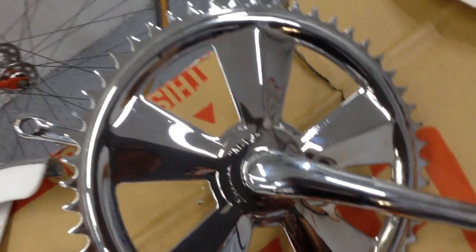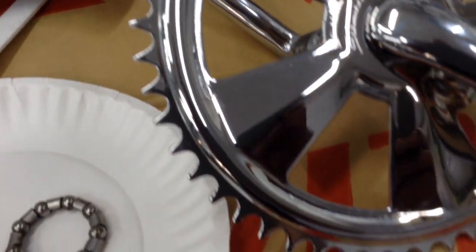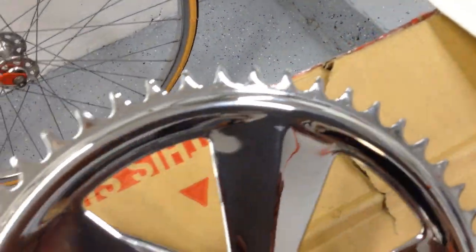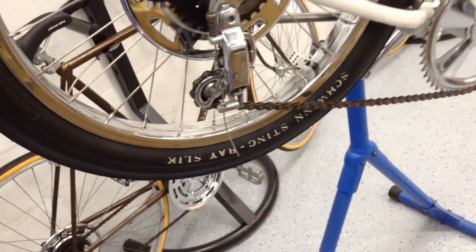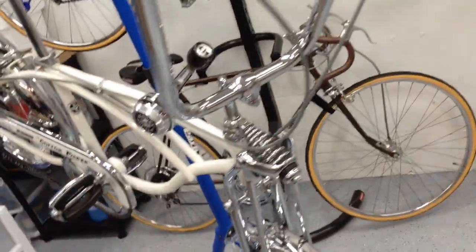I really hated taking off the beautiful sprocket they put on here — look at this thing, it's totally re-chromed. But as you can see, the teeth just have that extra layer of chrome, and that little bit did not allow it to interact with the chain properly and it kept going out. Very glad to see it all together. I'll probably tweak it out a little bit — I see a few inconsistencies like some of the nuts and bolts could be corrected, but for the most part the bike is very correct.